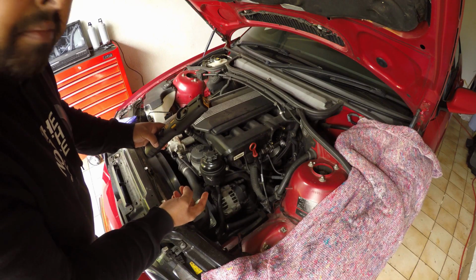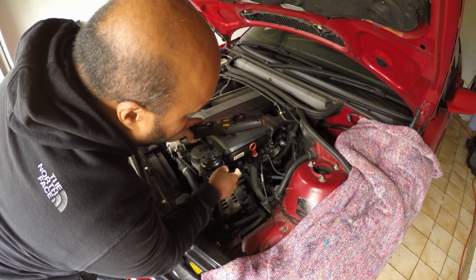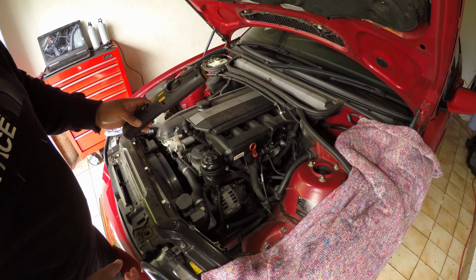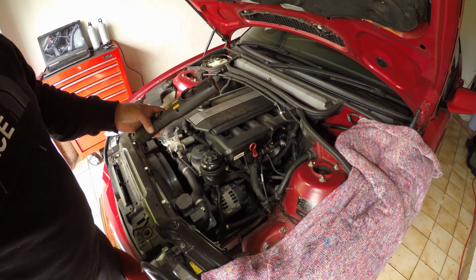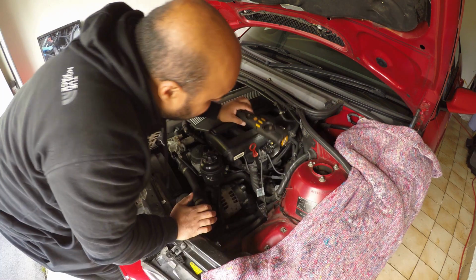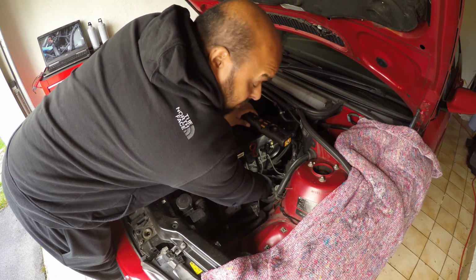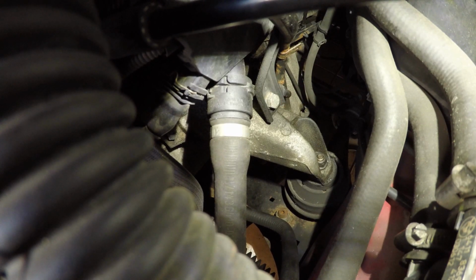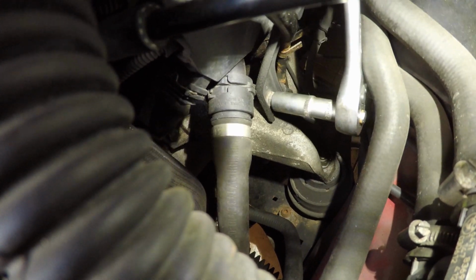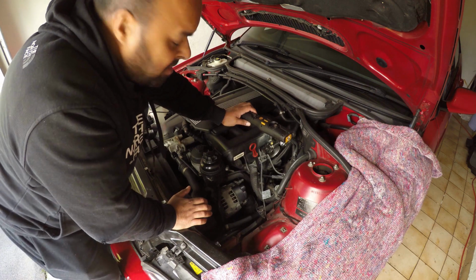We have to take the dipstick out first, remove this electronics box like he said, but I guess we'll be able to gain access to the CCV, which is buried underneath the intake manifold. And to start the dipstick tube, we can take off the screw down here. See how close we can hold to Jason's process.